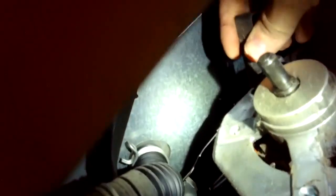Alright. When we put on the water pump, we have a little clip right here. We're going to put it back in to get ready for the water pump. Put the water pump back where we want it. And it has a slot here that the shaft has to go into, but the shaft has a certain shape to it. It may not be where you want it. So if you want to turn the shaft to match what the water pump's doing, you can do it right here with your thumb. You can move it into position. I think they match pretty good now.